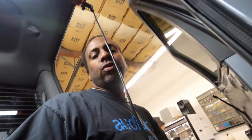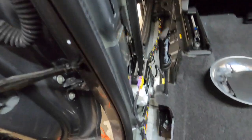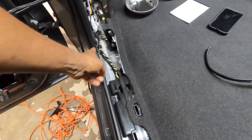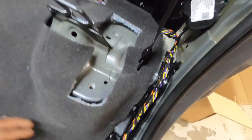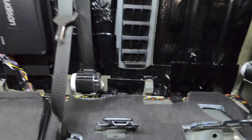Stay tuned — we're going to break this down and go forward. So we're in day two of the Chevy Silverado 2023. Wiring is pretty much done. We still have some wiring to do up front for the radio connection, but we've literally run all the wires. We ran separate wires for the tweeters because everything's going to be active, and we also have a bass knob.